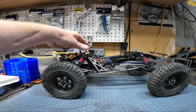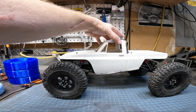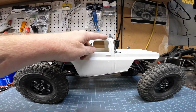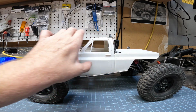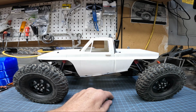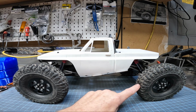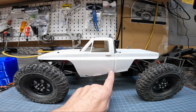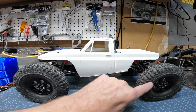So, then of course I got to get full interior. Still not sold on the height of this portion. I have half an inch that I can actually drop it down per the SORRCA rules. It has to be 4 inches from the bottom of the slider to the top of the cab, at 2 inches in front of the leading edge. And my restrictor on that is the height of the slider. It can be no higher than the tops of the rims.